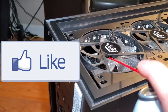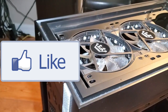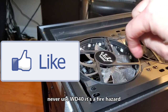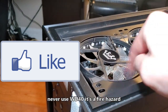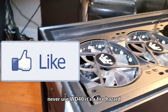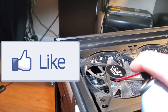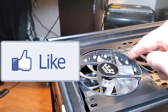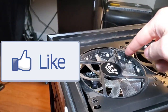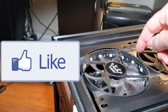It is not spinning right. You might have to replace it if this doesn't work, but sometimes the electronics cleaner does the trick — it evaporates, by the way. Just work it in there. A lot of people replace these fans, but don't replace them — you can actually fix them.